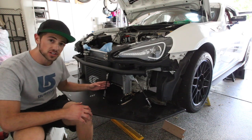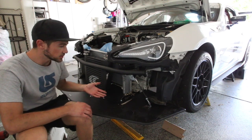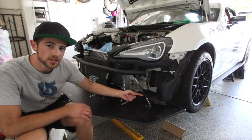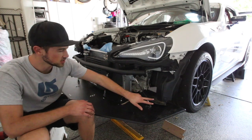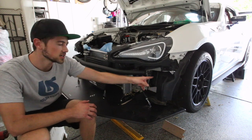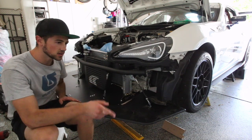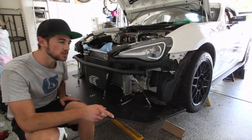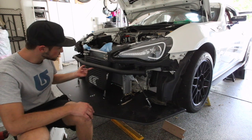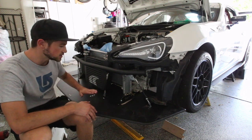With both the splitter diffusers and skid blocks mounted, I put the splitter back on, made final adjustments with the splitter rods, and used the level to make sure everything was sitting level — basically the splitter is done. I also attached the fender liner to the splitter rods using zip ties because I'm not attaching the fender liner to the front bumper underneath the splitter, so zip-tying it prevents it from flailing back and touching the wheel. Then I put the front bumper on and made any trimming needed in case any splitter rods touched the bumper.